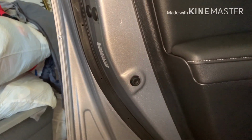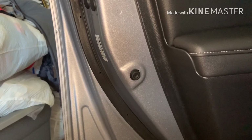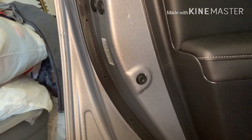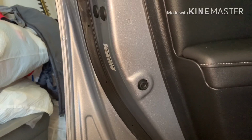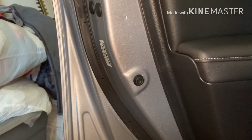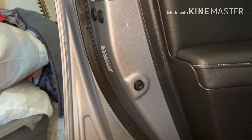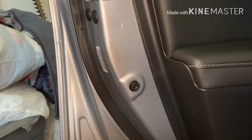If you are adjusting these, be very careful and look at it, because there's no saying when the last time you turn it is going to be when it falls in. There's no way to tell, because you can't see the grooves anymore. So just be very careful and hold on to it as you're doing it, or else you're going to lose them inside the door. And I'll put a part number in the description, so you guys can order it if you do it.